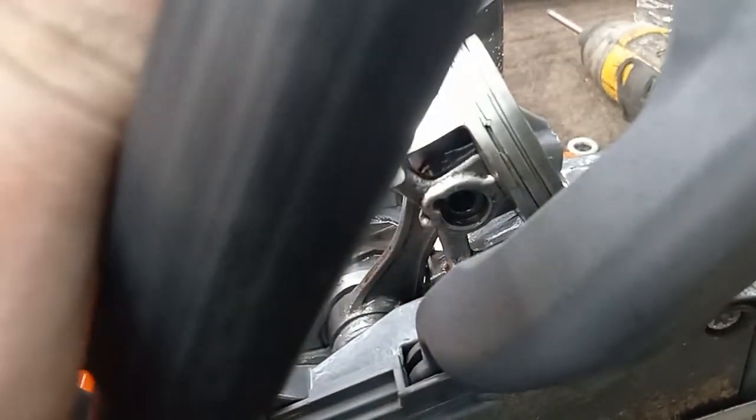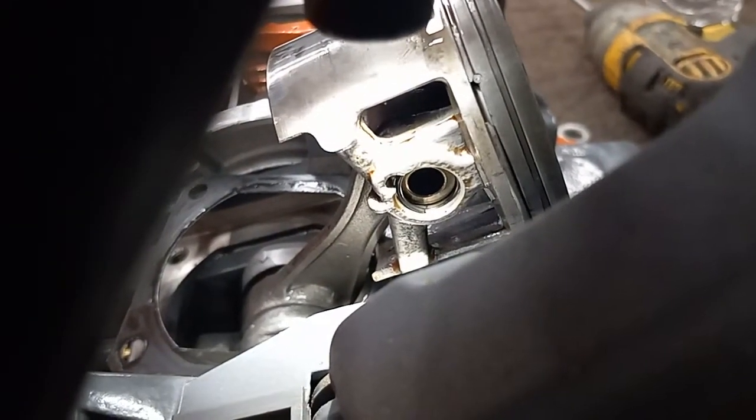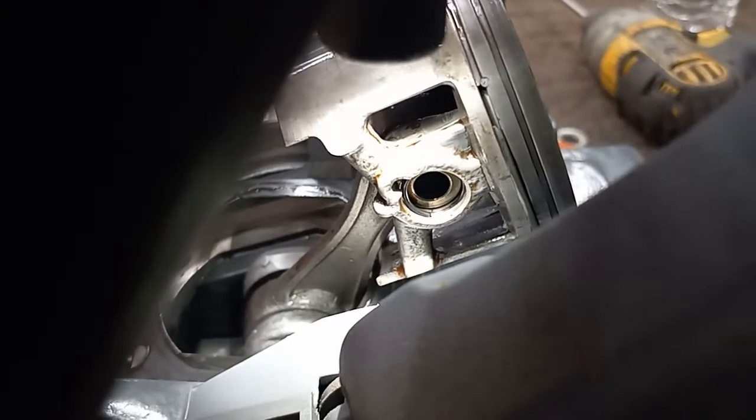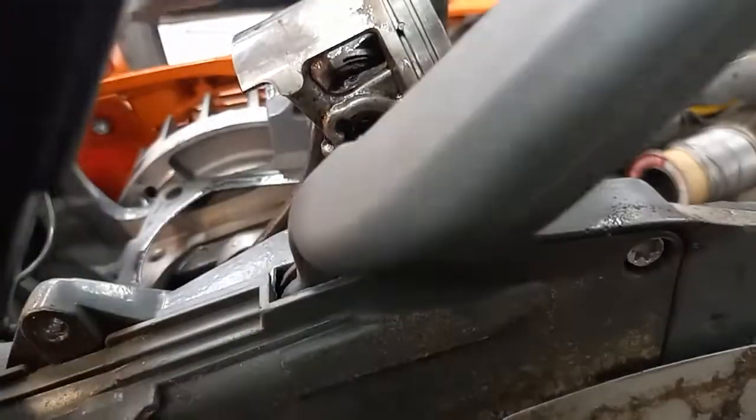It's got a nice big windowed piston. That circlip is half in, half out — and it's like that on the other side as well. That really concerns me, because that circlip was about ready to pop out, go into the saw, and cause catastrophic failure. This piston's got to get pulled — I like the big windows in it, but it needs work.